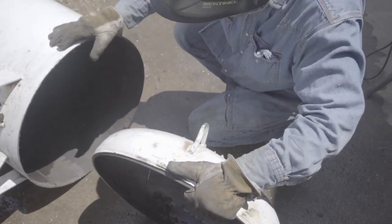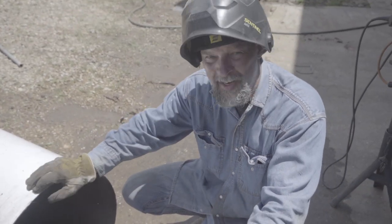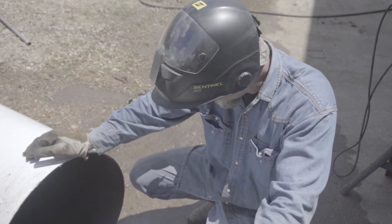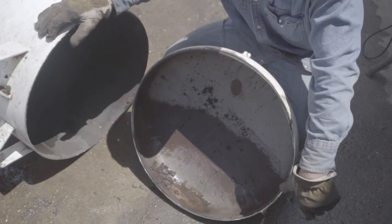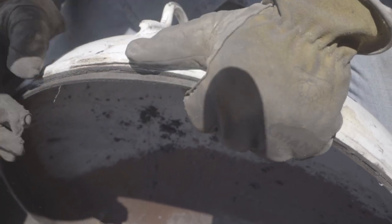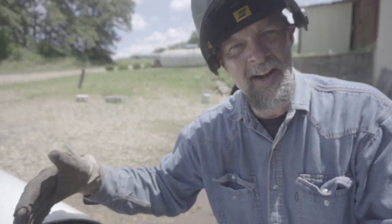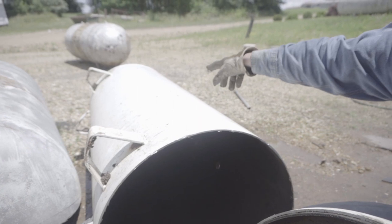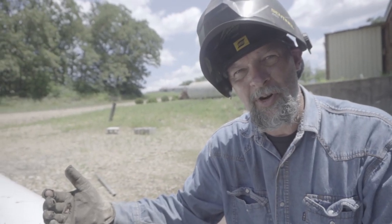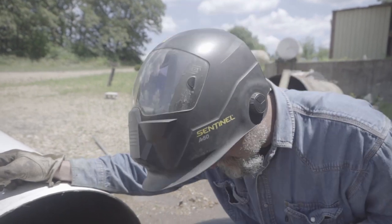So this tank's a little bit thinner than I thought it was — it's like in between 10 gauge and 7 gauge. It wasn't that bad at all to cut off with a Metabo. Notice there's a piece of this head right here that is swedged — that's why I didn't cut on the seam. I cut a little bit away from the seam and I was still a little bit close. Now if your cut is off, it's not a big deal because you're going to have a big old nice flat firebox that you can use to help mark it with. You can also mark from the center of your weld seam over — that weld seam is generally pretty darn square to the tank because it's a mechanical process. Look at there — we're empty.